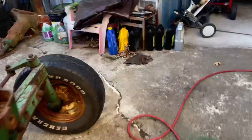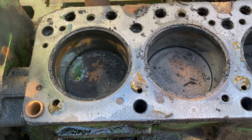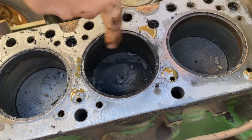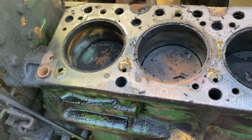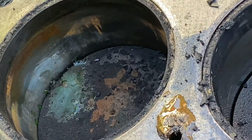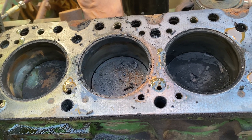There's a little bit of rust here in the number one cylinder right here. So my guess would be water got in there and probably rusted the rings — that's why I had low compression, 60 to 75 pounds. But the good news is it really doesn't look that bad, not as bad as the 65-1010 I took apart. I should be able to put a set of rings in there and get this thing back together.